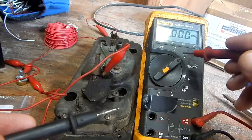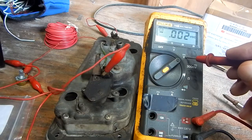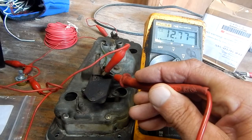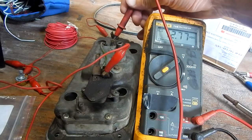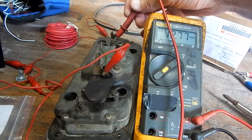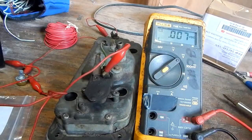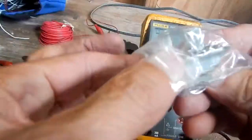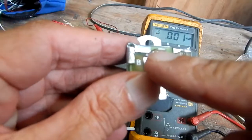Visit eaglerunnerbill.com. Eagle Runner Bill here. I have this voltage stabilizer on the back of this instrument cluster. I don't really know what it does, but my instruments aren't working, so I'm going to go ahead and change it out. I found it on eBay. My output from the stabilizer is giving me 12 volts — exactly what my battery input is — so something isn't right.